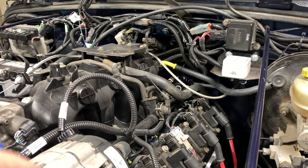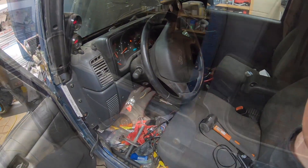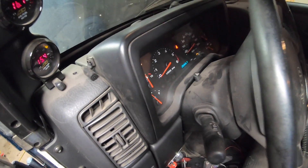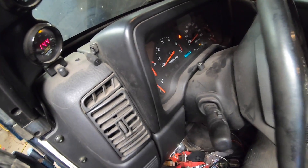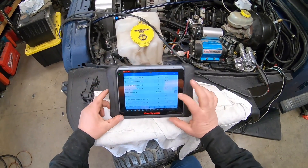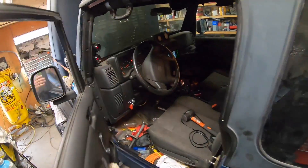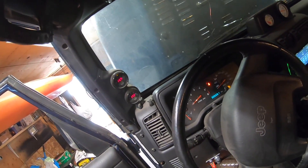Not going to throw that cover back on — we're going to do a little better idle while everything is doing its thing. I should have brakes. There, they're pumping up now because they were drained full of oil for the longest time. My short-term fuel trims are right about where they're supposed to be, close to zero — roughly 14.